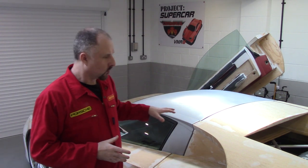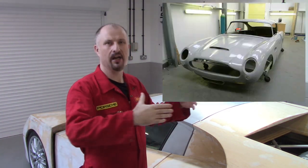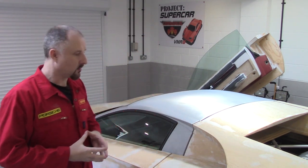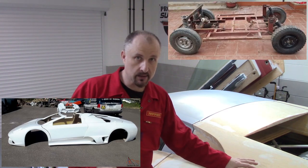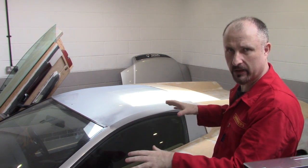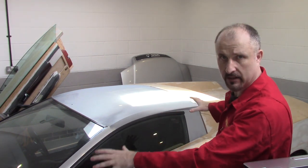Because once you've made your plug and then made the body shell out of fibreglass, you only have a tiny fraction of the overall car — the body makes a very small percentage of the entire project. A lot of people get stuck in this trap: they'll buy a kit car online, get a shell and a rudimentary chassis, and then it's up to them to engineer the rest of the car — which is 99% of the car — and often people struggle to finish the build because of this. You really do need to lay out your entire car mechanically first — seating, steering, everything — and then try and get your design and styling to fit the mechanical parts.